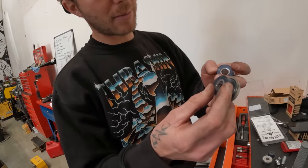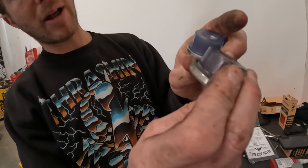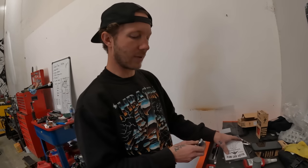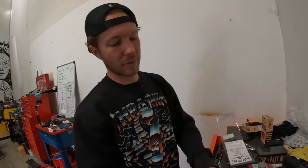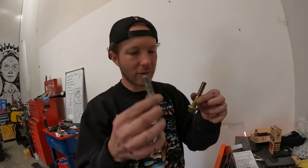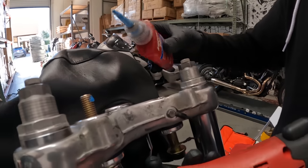You can see where the paint was chipping and it's rusting. The old ones have good tight bushings but they're already compressed and blown out. Let's put fresh ones in, and while we're at it put fresh bolts in versus the old ones - who knows, these could be 20 years old. Put some blue Loctite in.